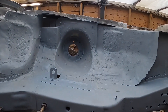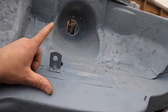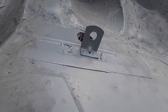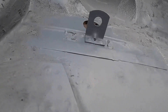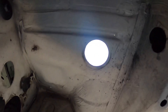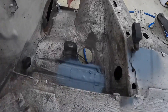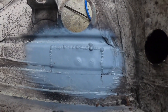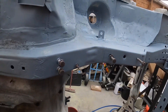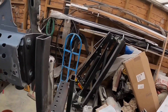I've also been tackling the front arches - both front arches. To be honest it's been pretty rust-free. The only issue I've had is with the front brake line brackets where they fix. Once we removed the sealer, there's quite a bit of rust behind them, so I've put a nice patch in there. We'll just show you that from the other side - it looks pretty factory. This is the other side of the car. I haven't ground the inside back like the other side, so that's the patch we've welded and we'll get it ground back. I've just sealed it for now to stop any rust happening.